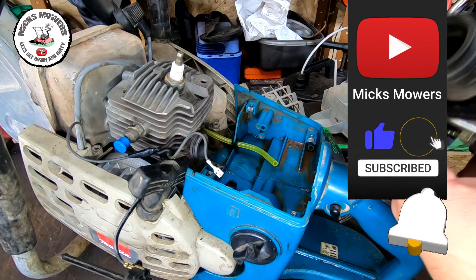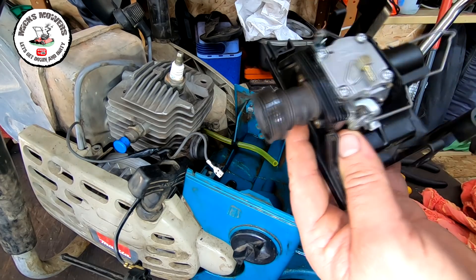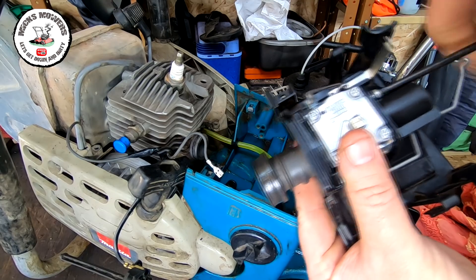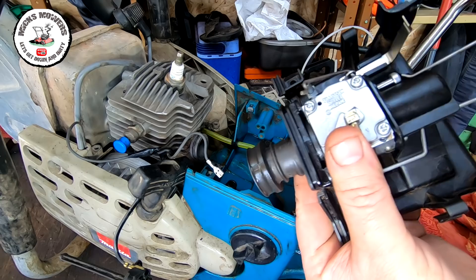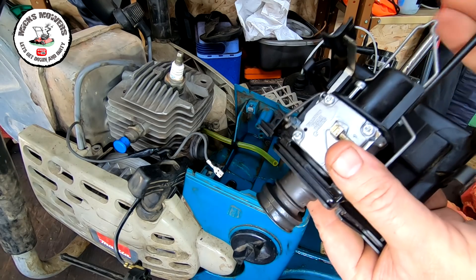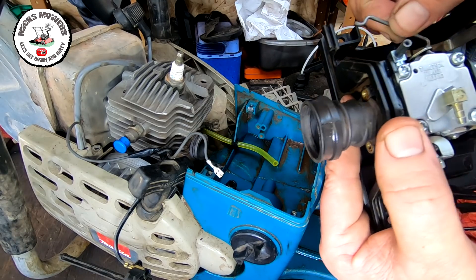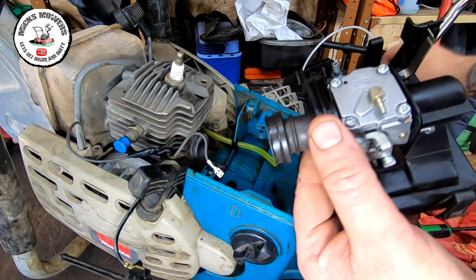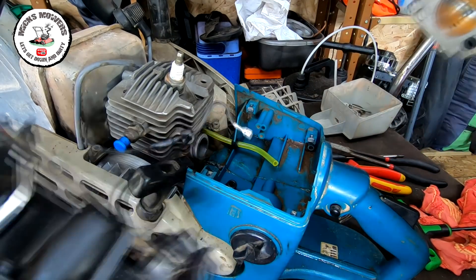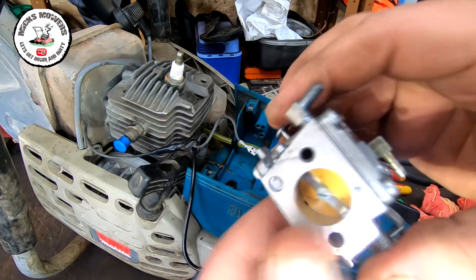Here's the carburetor itself. Make sure you keep all the bits and pieces — they're very simple to remove, literally just two screws here and that then removes. You can take the carburetor out of its housing, which is very simply done with a Torx bit. I'm going in here because he asked me to get him a gasket diaphragm set, so I'm just curious as to if he's set the carburetor up right. We can now remove that linkage there, retract the bolts, and that carburetor should just come straight out. Just make a note: the pipes are on the bottom, not on the top.